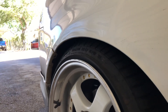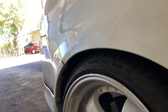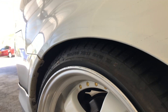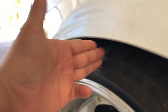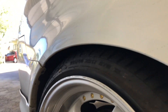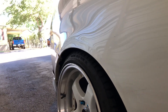On the back, I might be able to go a little bit lower. I also forgot to mention — I did get the fenders rolled, both front and back, just in case we rubbed. So far no issues with the coilovers, doing pretty good. The only thing I'm getting is a little bit of a knock in the front, but I think that's because the splash guard is messed up and rubbing when I turn. The backs are good. As you guys remember, in the back I had about three fingers of gap before — now we're down to just one finger. Pretty good fitment, and these are still at the preset settings, so I could still go lower if I want.